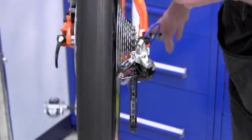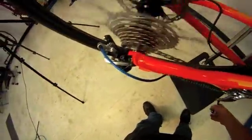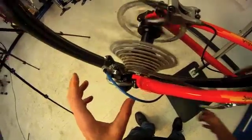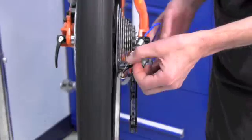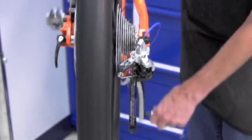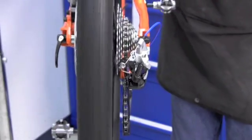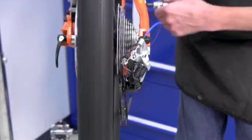This is difficult to see — let's pan in a little bit better. The guide pulley is actually a little bit outboard here and we do get a funny noise. I'm going to just gently push — see that? It really tends to quiet down. So we want that pulley to move inward more; we want to take up slack. Taking up slack means the barrel adjuster coming out. That extra rumbling has gone away. One click at the shift lever is giving me one gear in back.